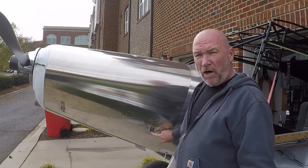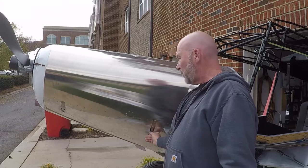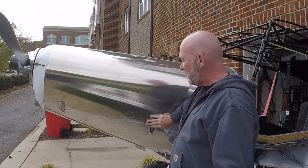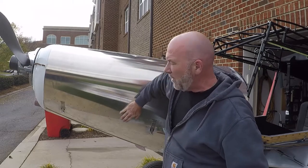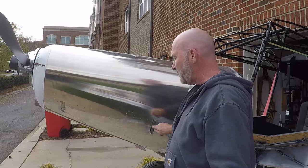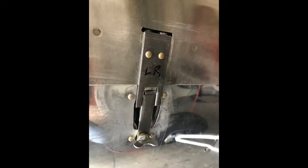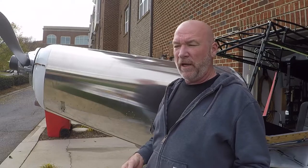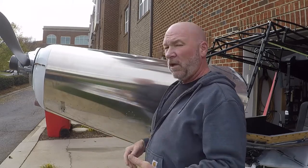Let me talk about the cowl doors. These are the Piper-type latches you see on a lot of Cubs, Super Cubs, and Pacers. I wanted this style because when the doors come down they get a little grip and pull in tight so there's no flexing or wobbling. I like the retro look, it fits the utilitarian aspect of the airplane, and I like how both latches just pull down and secure the cowl door. Let me go around, open everything up, and we'll do a walk-around.